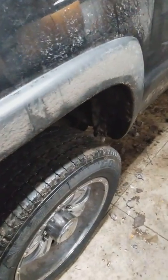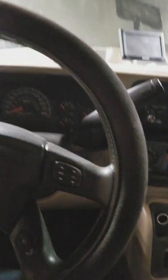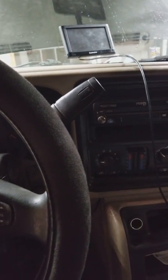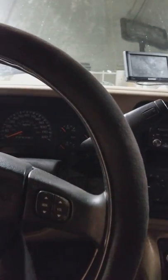I did have an issue, believe it or not. The transmission started doing a stuck in tow haul mode. I couldn't figure out what it was, because the light wasn't on the dash, and pushing the button would illuminate the light, but nothing would change when you turned it off. So that was just oh so wonderful.